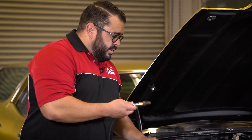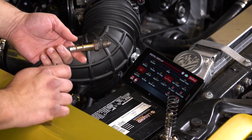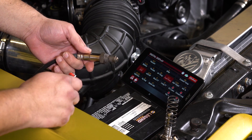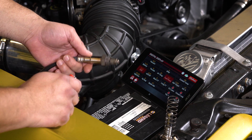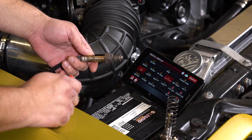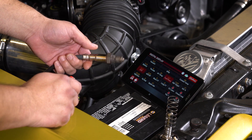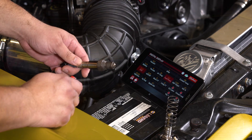The only tool you really need to check the O2 sensor is just a cigarette lighter. This is a Bosch LSU 4.9 sensor — that may not mean a lot to you, but what it does mean is that it's an OEM grade sensor that on most modern stock OEM cars will last hundreds of thousands of miles, so generally you'll get tens of thousands of miles out of a sensor. Usually these don't go out; they last a pretty long time. But if for some reason it becomes suspect in its readings, this is how you would check it.